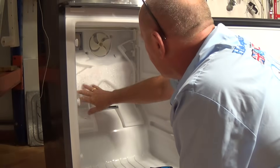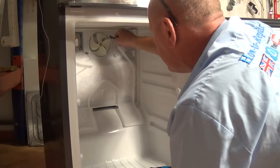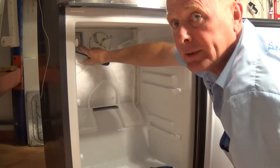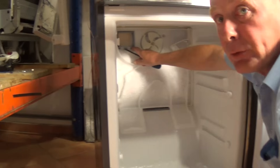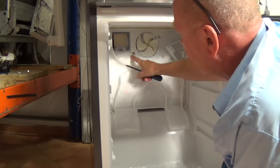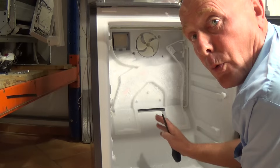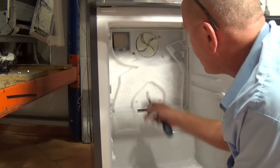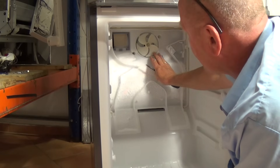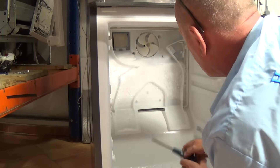You can start to see the ice here, but we need to remove this to get to the matrix. This is the hole at the top here on the right-hand side — this is where the air blows up to the fridge. You can see ice has built up here and also here; this will all restrict the flow of air going to the fridge unit. The fan spins, and sometimes the ice builds up to such an extent that the fan will even be hitting the ice. We need to remove these two screws at the top.